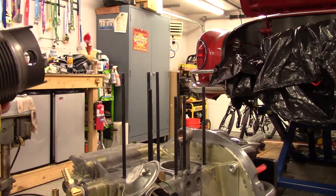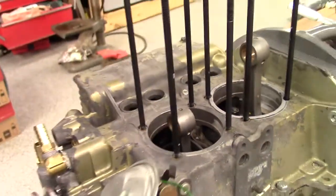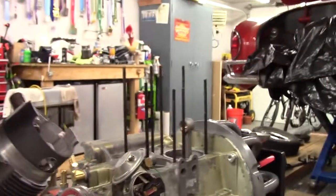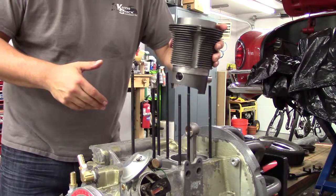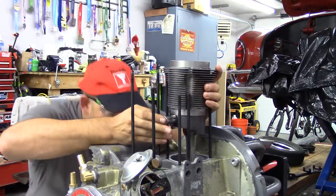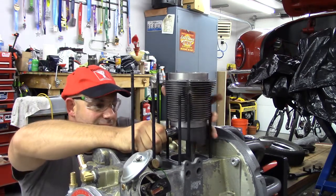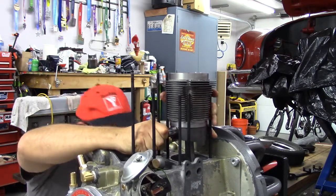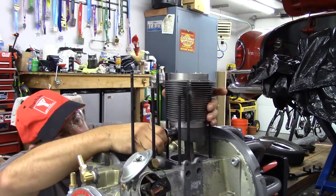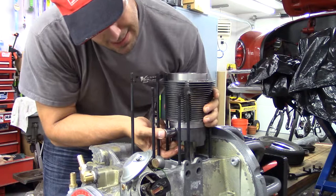Alright, surfaces are clean, barrel's cleaned up. If you look at that cylinder on the left, you'll see a gray ring — I laid the shim on the case itself as opposed to sticking it on the barrel, because with the barrel pin out I can't clear it. But this should work just fine. Now I'm going to finagle getting this thing back in here. Hopefully this will be pretty easy and we'll get it sealed back up.